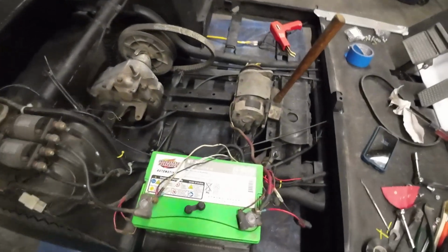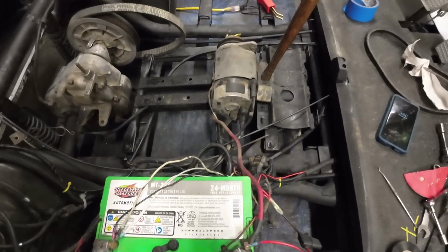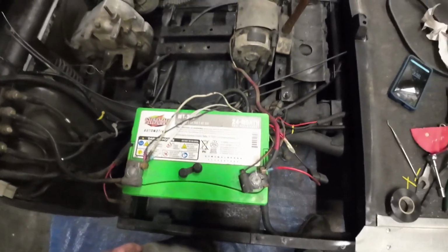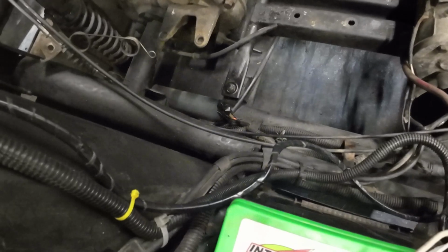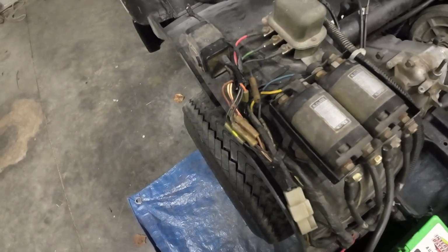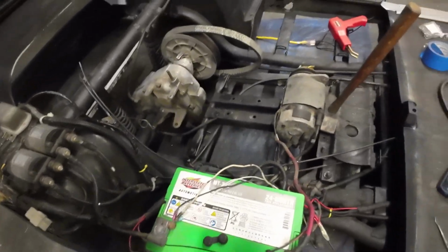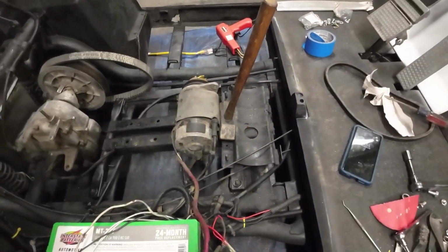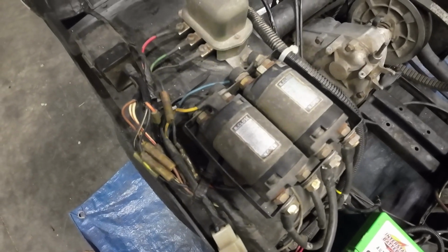Well, I just took the time to hook that starter generator all back up, hook up the battery, all the wiring. I went through, anything that wasn't going to be used, I knew wasn't needed, I taped off just to be sure. I put the CDI box back in, wasn't sure if I was going to need it, but couldn't hurt. So I already tested it and ended up making sure that reverse was not going to work.